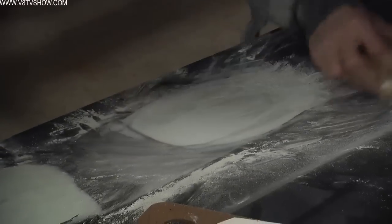That's nice especially on a large application — it doesn't wear you out. The first few minutes if you're block sanding the car by hand, there are various tricks to properly sanding body filler. You might find initially that there are some high spots that you need to knock down, and it's recommended to use a more coarse grit of sandpaper over something like a cheese grater type file, because the sandpaper will bring those high spots down uniformly without carving new trenches into the filler.